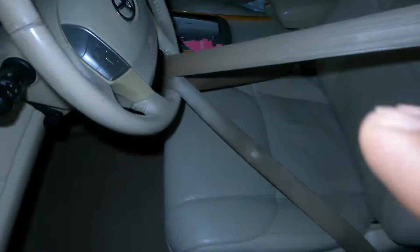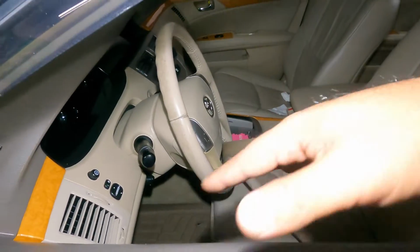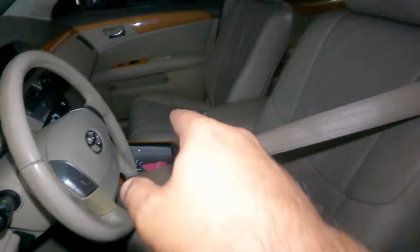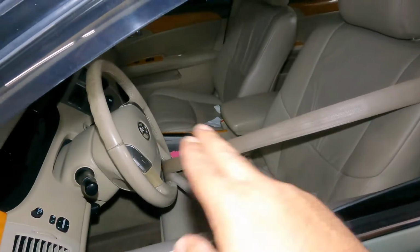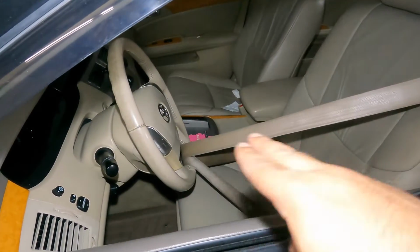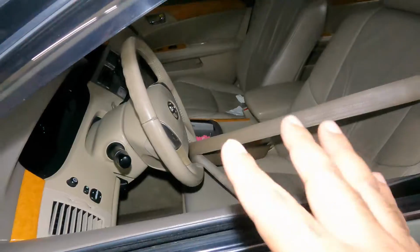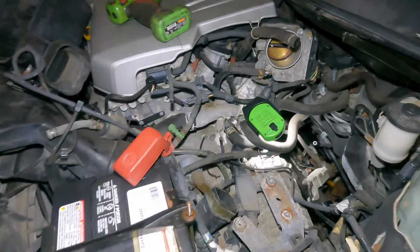We had the wheels straight when we removed it. Both of the wheels were straight. So make sure you straighten out the wheel. You can't be on one side either. Straighten it up and then straighten up the wheel, lock it up. That's why we're gonna straighten up the rack and pinion right in the center. If you go to one side, it comes back, it makes 3 full turns. So you gotta go a turn and a half, probably a quarter turn. We're gonna center that. Right now we took out the air filter housing here.